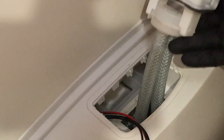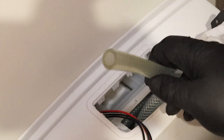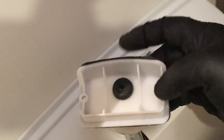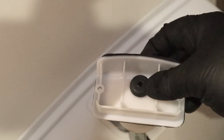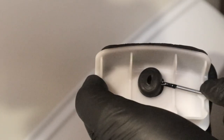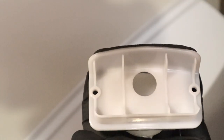Right, let me show you what we've got then. So obviously I've removed the existing pump already as you've seen. The pump goes on to that pipework there and the cable needs to come through that grommet there. Now the new kit also comes with a grommet, so the first task is to remove that old grommet. I'm going to use a small screwdriver — just deform it, squeeze it in from one side and pop it out like so. There we go, that was easy.